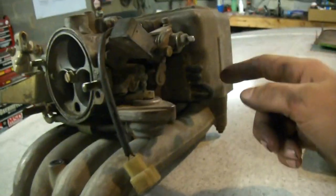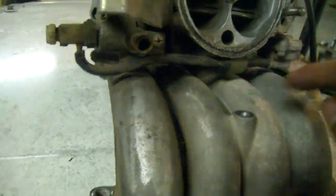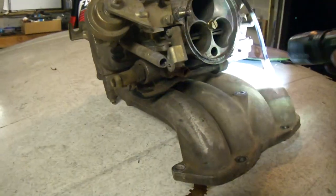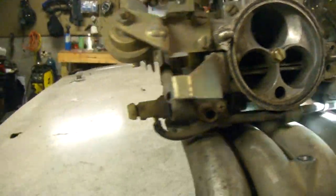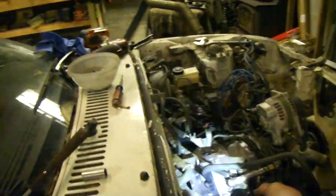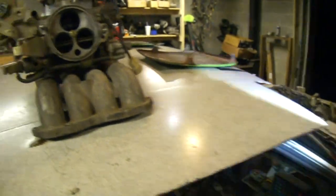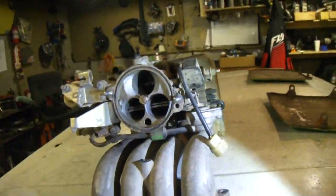To recap, staying on the upper intake manifold — all those little things I told you to block off, you can loop them because they're the same hole, and that still blocks it off. There is a little straggler down here on the bottom of the throttle body — don't miss him. This is basically your choke, controlled by the Thermo Wax, and it runs this front set of blades. Mine's not hooked up to anything. If you don't even have coolant running to the Thermo Wax, just loop the line — take the rear iron coolant line and loop it, or use the port on the back of the thermostat housing. Block those boys off. That goes to your intake boot — you can leave it. That's pretty much it for the upper intake manifold.